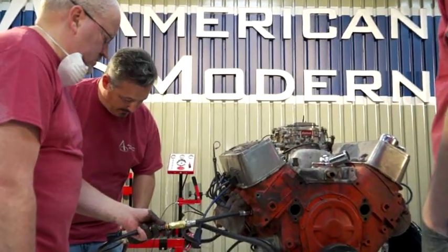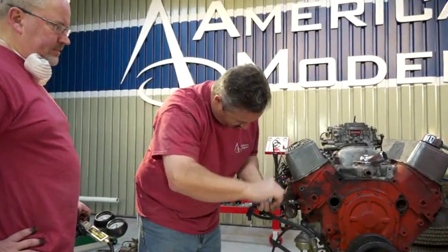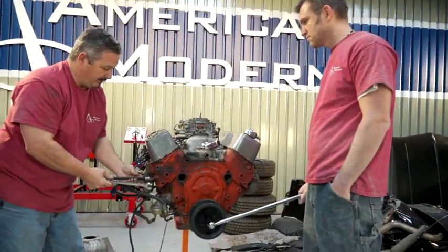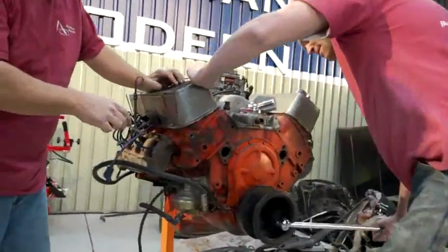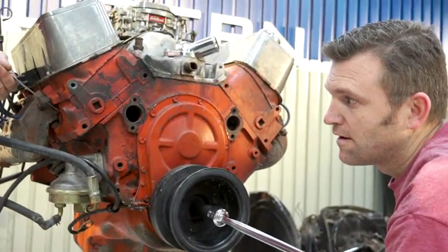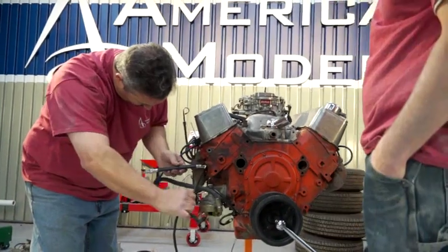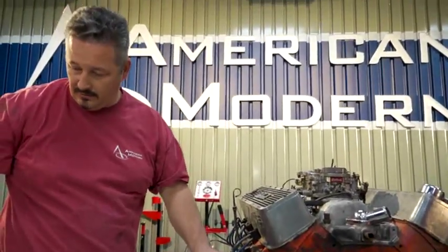The reading is moderate right now, but we need to make sure that we are on the compression stroke, so let's go ahead and disconnect. Let's try one more time, Brian — go back and make sure we were right at top dead center, because if we're off just a little bit, it will open just a bit. We still have good compression, but it could be worn out where it needs honing, or we might have to put a set of rings in it. Not sure.